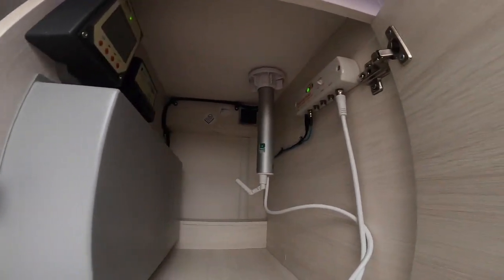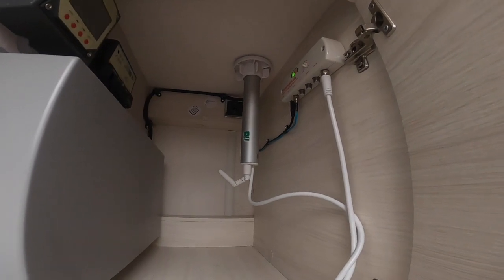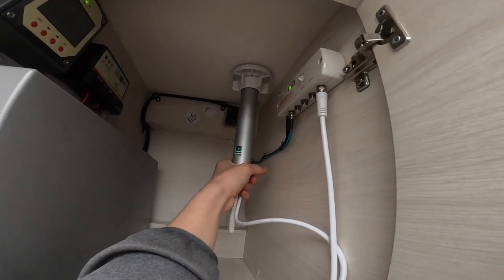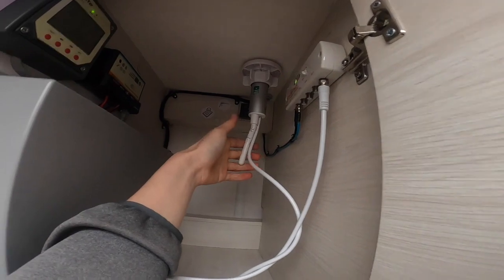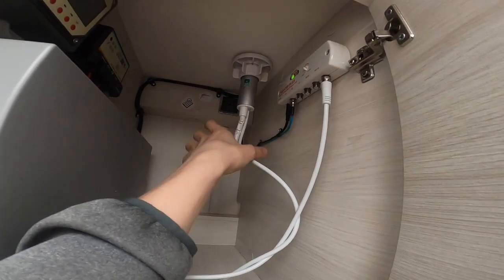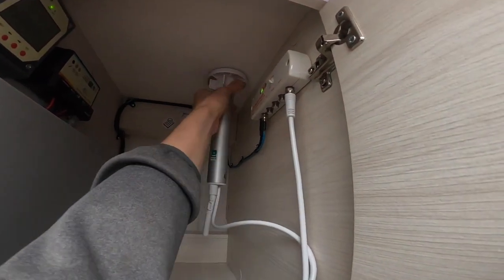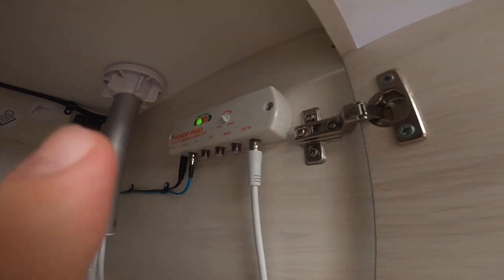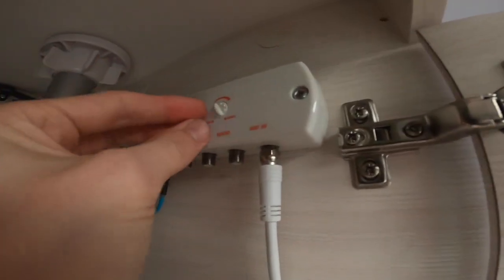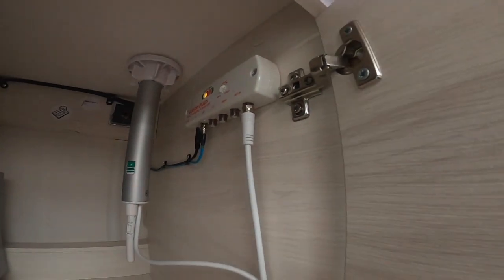In the cupboard above the fridge is where you'll find the location of your Vision Plus Status TV aerial. If you are struggling to get a picture on your TV, you may need to loosen off the top nut, look where other motorhomes and caravans are pointing where you're parked, push the pole up, and use the little toggle on the bottom to direct the aerial. Always ensure when travelling that the aerial is pulled firmly into the vehicle and firmly tightened. Once you've got the switch on beside the control panel, the amplifier will work — if struggling to get a picture you can boost the signal, or if it's too strong you can turn it down until you get a steady picture.